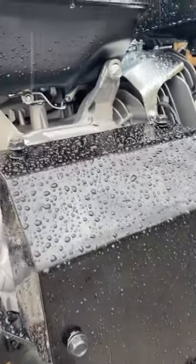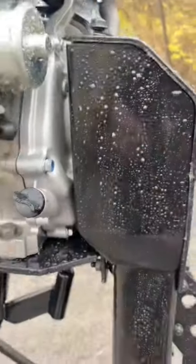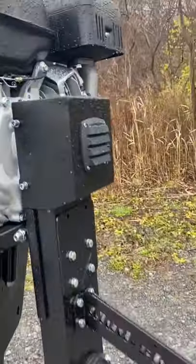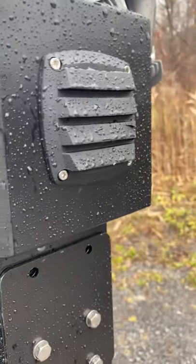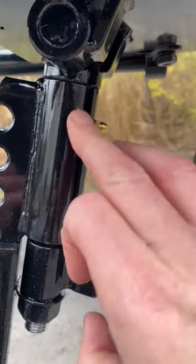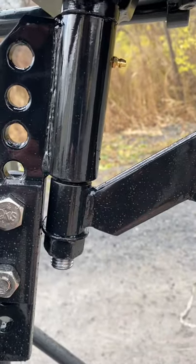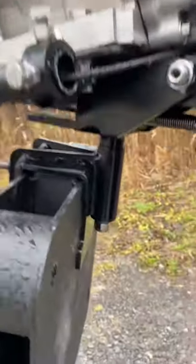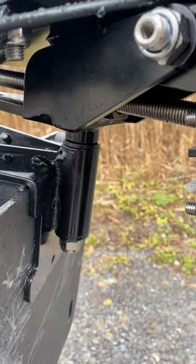The main cover of the SD300 is held on by six bolts and has no vent of any kind — no way for air to get into the body of the unit. The 13 light however does have a vented case, which allows air in to dissipate clutch heat. On the SD300 there is no bushing or bearing down the main sleeve — just a center steel rod that runs right down the center, which you want to keep lubricated. On the Mudskipper light surface drive there is a bronze sleeve running down there, which makes the kit turn a lot more smoothly.